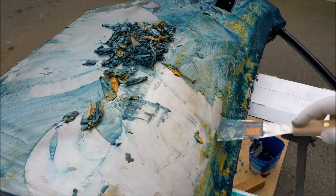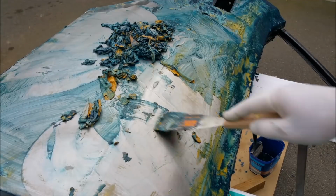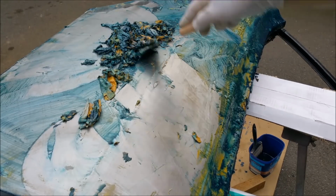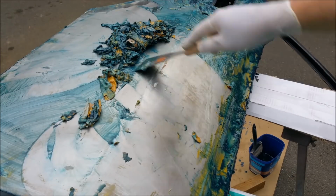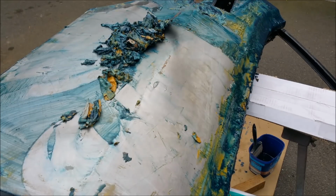So whoever bogged it used a ton of it and formed a new shape out of it, but they did it on very clean metal, so no rust formed. Whereas this has little bits of surface rust like that, and that's very easy to get rid of. Those paint stripper discs on your angle grinder will just wipe that straight out. You don't have to do anything else.